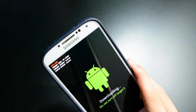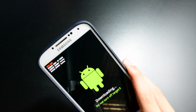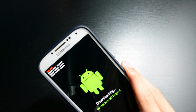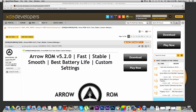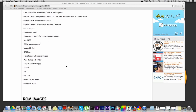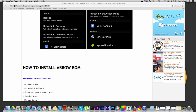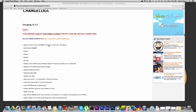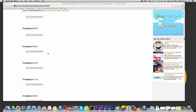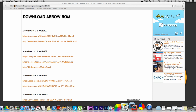Now we're gonna move to the PC to flash the modem. Remember that you need to have the Samsung drivers installed and have Odin. Now we're on the PC. This is the page of the ROM, which I will have in the description. You need to download two things from here. The first will be the modem, which we will flash right now, and the second thing would be the ROM itself. So first up here we will have the modem, and if you scroll down we will see the ROM, which is version 5.2.